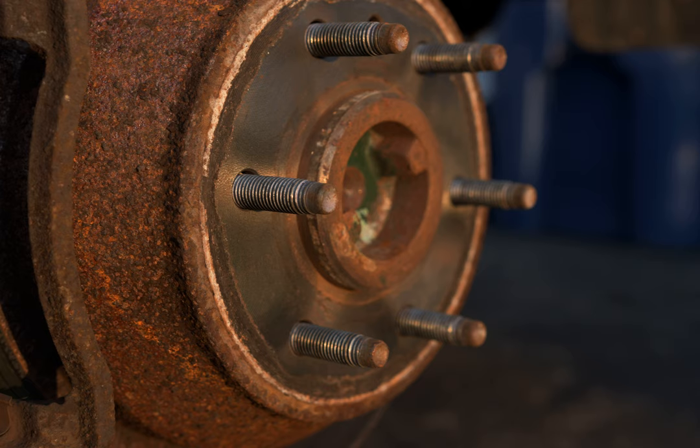To do this properly, you need to replace all these parts: a new frame with disc caliper mounts, a new fork with disc caliper mounts, all the brake system parts — being calipers, rotors, hose, etc. — and new wheel hubs front and rear with disc rotor mounts, plus longer replacement spokes for your front wheel to rebuild it with a cross lacing pattern.